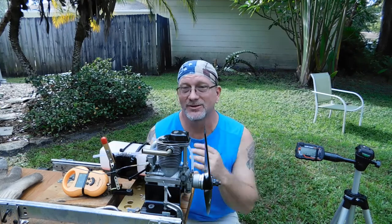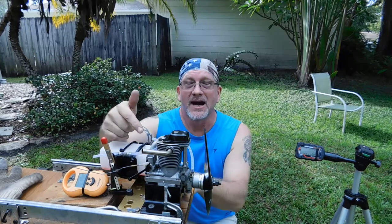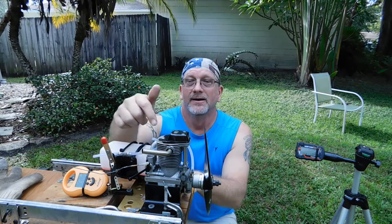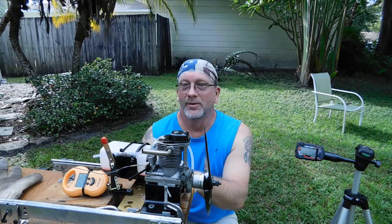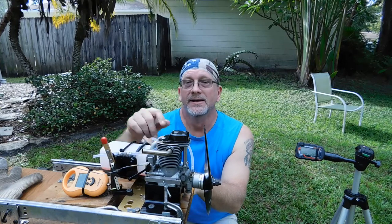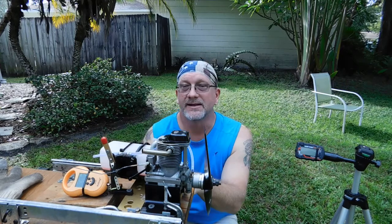So the things I've done to it was, I put my exhaust header on it with a copper seal that goes inside there. That's probably why, Ray, you had this sealed all up with RTV, because there was no copper seal in there to actually provide the sealing. So I've got my exhaust header on there with my copper seal to seal that up. There was no leaks there.